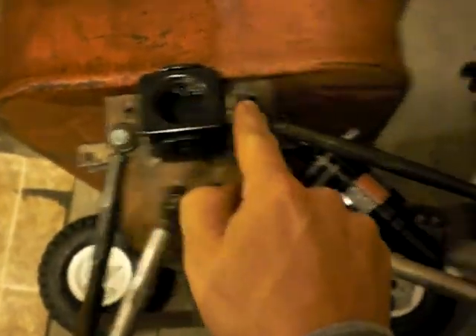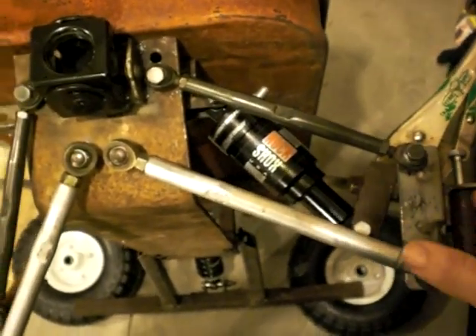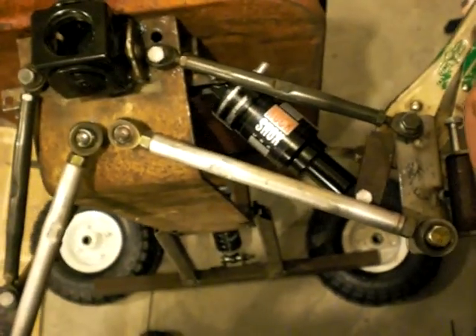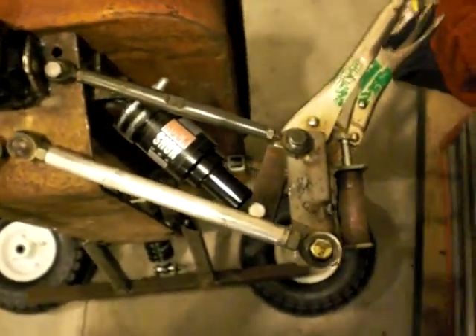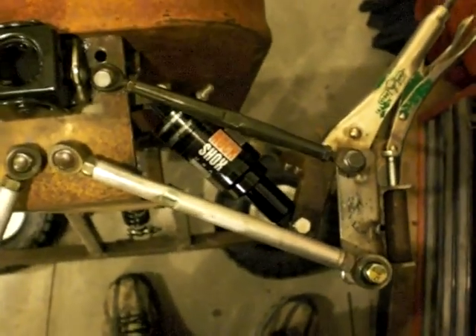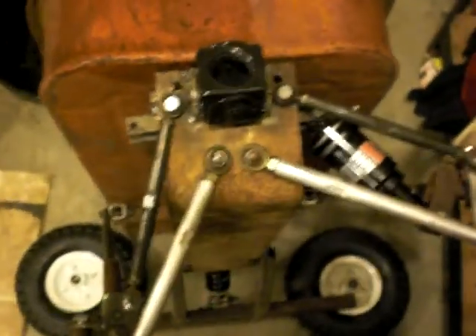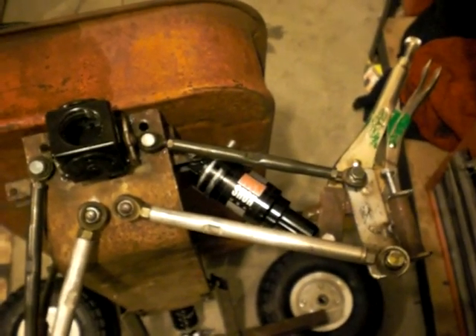As it drops down farther, this distance begins to get significantly closer and becomes too short, which meant when the suspension bottomed out the tires would be pushed out, giving me a toe problem in my alignment. Anyway, I know I haven't given any updates on the wagon, and that's because I ran into some problems. Hopefully this fixes them — the front end is going to be about an inch and a half lower than it was before, which will help with the scrub, the steering, and the progressive softening of the suspension. It should cure all those problems.